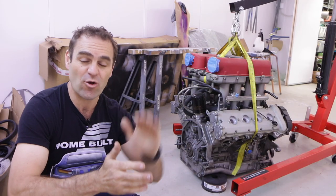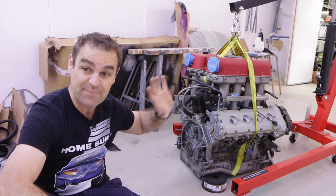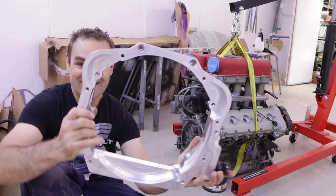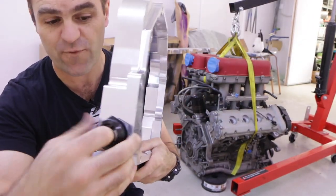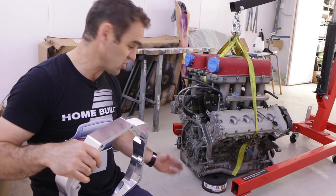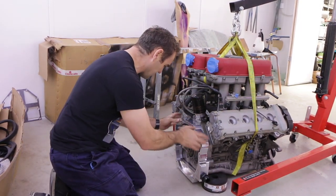Before we get stuck into things today on the boot floor, I thought I would take you on what I've actually been doing behind the scenes. Chris did a whole heap of work designing up the adapter plate to fit the Ferrari engine to the Subaru gearbox, and I sent that away to an engineering company to actually cut it out. This is what we got back — it's a beautiful thing. It's got an AN fitting in here, a nice smooth transition going through from where the oil is going to return from the oil tank in through here, through this hole, out of the adapter plate, and then in through — sealed by the O-ring — into the Ferrari engine, and that goes directly to the oil pump. That is how the engine gets its oil feed, and this thing is beautiful.